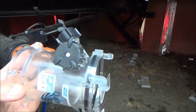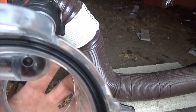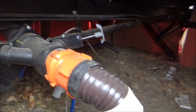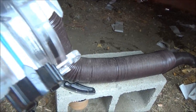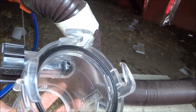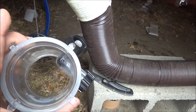It's clear, so I can see what's flowing through, and it also has a nozzle so I can push water through that little hole to go into the pipe and break up any clogs. There's also a nozzle on the other side that will clean out the hose completely — just hook up the hose and turn the knob. One position says 'hose,' the other says 'tank,' so by flicking the switch it will shoot high pressure water in whichever direction I want, and I'll be able to see if it's completely clean.